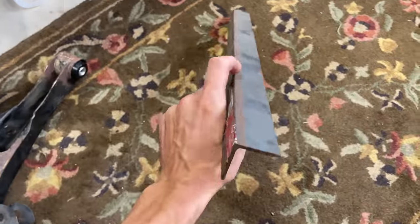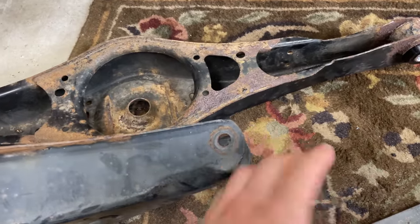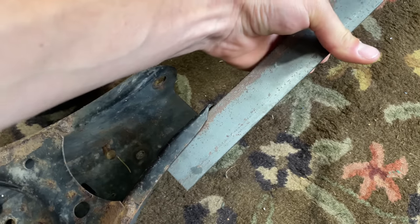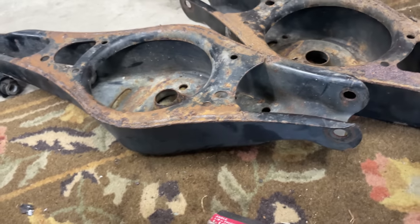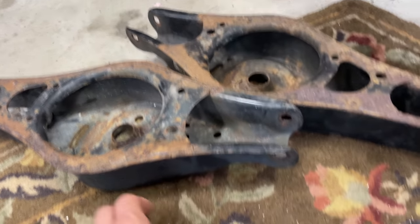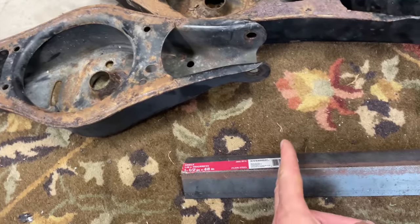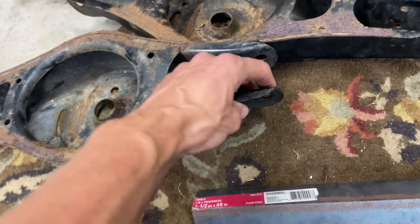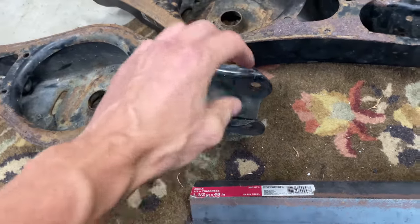We're going to trim off these side pieces and then drill a hole right about here, exactly 1.5 inches. So it's all measured out and equal, and I'll have some extended control arms, which is so exciting. If you look at these arms, we only have about 1.5 inches to play with before these arms start to contour out. My plan is to have 1.5 inches on the material itself and then 2 inches extending out, so you have about 3.5 inches of overall metal. Then we have 1/2 inch on the very end for structural reasons, exactly like the stock arms.